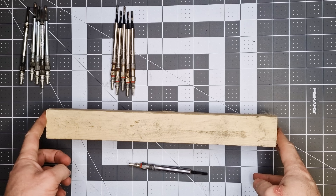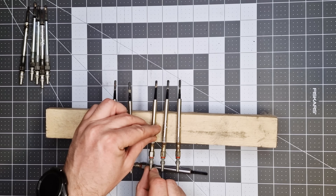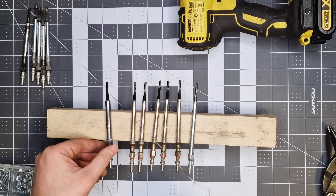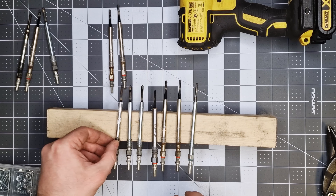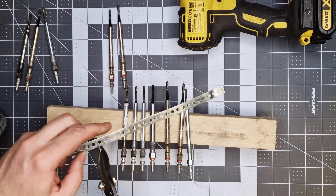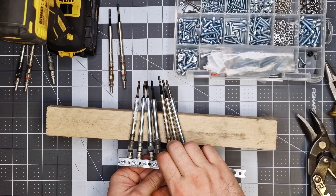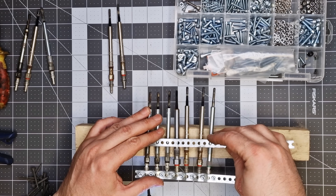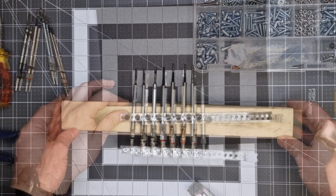The goal of this experiment was to see if there's a noticeable difference between old and new glow plugs. Over the years I've seen interesting cases — like glow plugs that only heat up in one tiny spot, or ones that take forever to get hot. I decided to connect multiple glow plugs from a D5 engine all at once to make the comparison more visual. While setting them up I noticed they were different in length — some were from a 2003 model while others were from a 2007. I assembled them using a wooden block as an insulator, secured with perforated metal strapping, small bolts and nuts for the positive connection, and screwed into the wood for the negative. The result was a pretty solid structure.